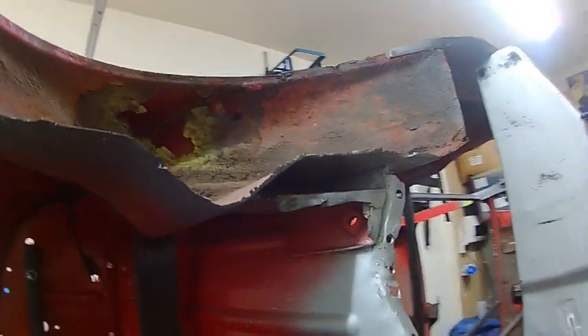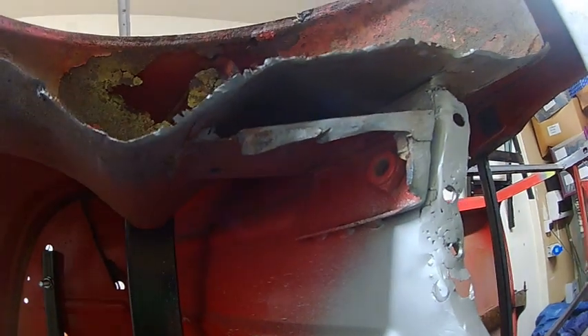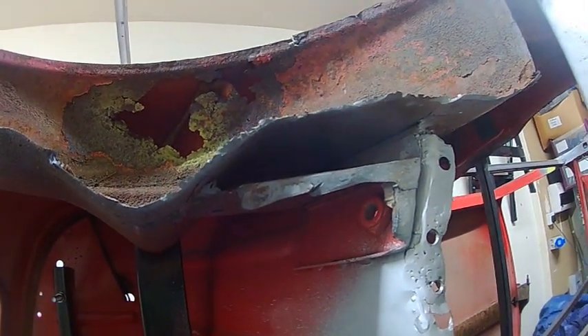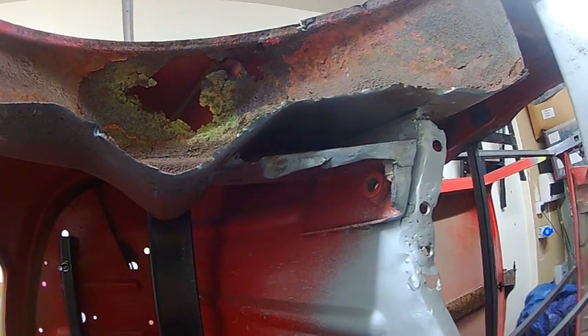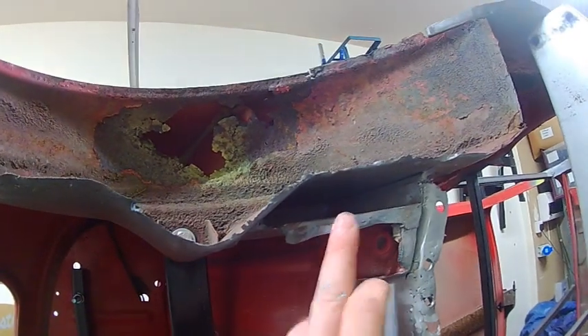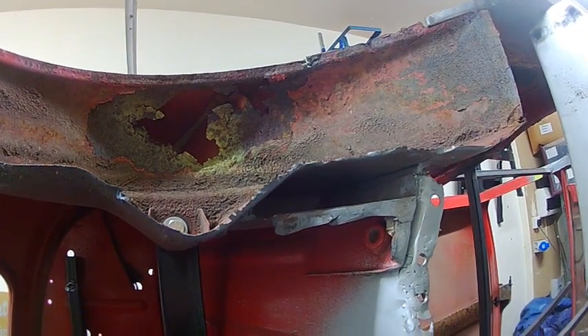This one up here — I'm still undecided. I do have the parts to replace it but the only bit I'm concerned about is this bit here. So what I'm going to do is get it all cut back, see how good the metal is, and see if I can either put a patch in here or if it's going to need replaced. I need gas for the welder and it's a Saturday — why is it always happening on a Saturday when the shops are shut? Anyway, cut this back and see if it's going to be kept or replaced, and then I can get the boot floor clamped in place and welded on. It's been far too long. I'm going to get the boot floor attached as best I can and then break the videos down for Elnor into stages — cover a wheel arch, cover the rear valance, and so on.